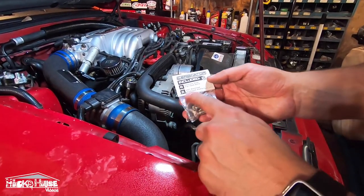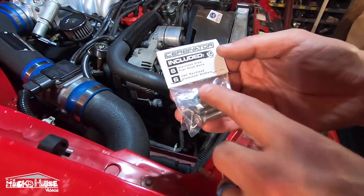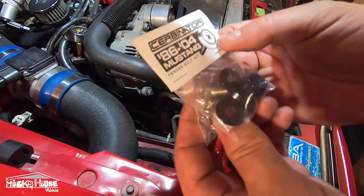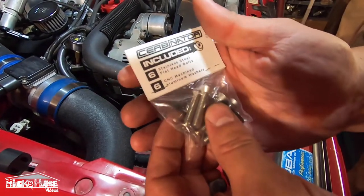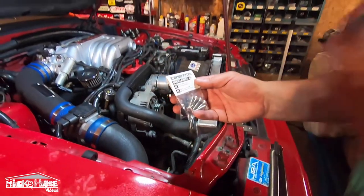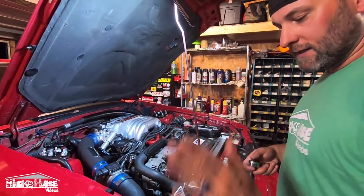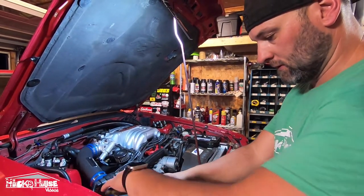So look, it comes with the 6 stainless steel bolts and CNC aluminum machined washers for it. I got these with silver and black just because I like that look. And I didn't have time to put them on my car, so Jesse, you get lucky. I'll get another set for mine after Mustang Week. So let's get this going. All right, guys, what we're going to do is take them out one at a time, and you shouldn't have to worry about your fender moving at all.